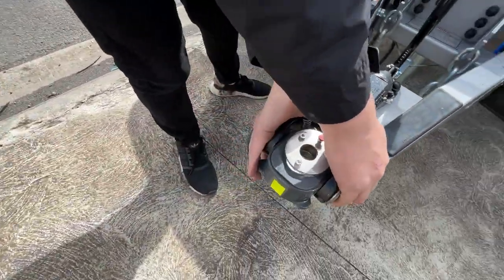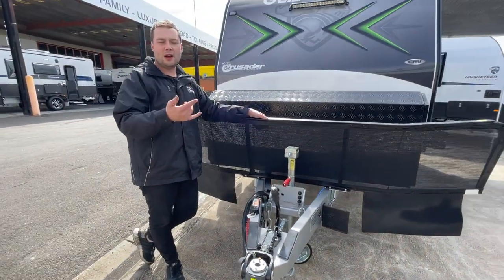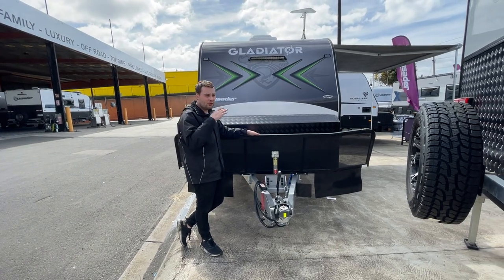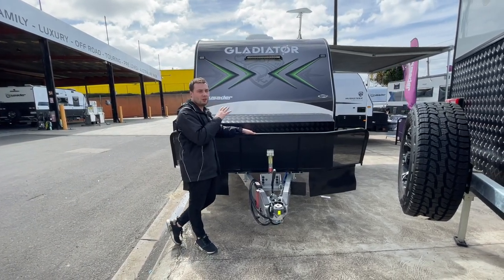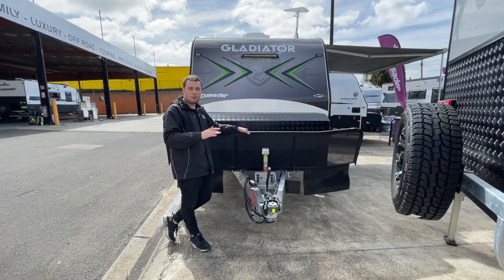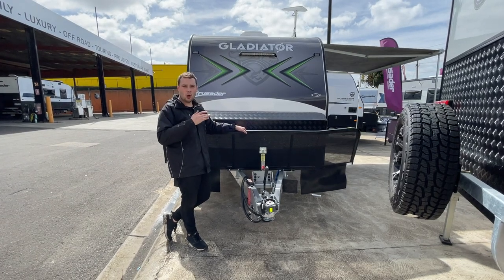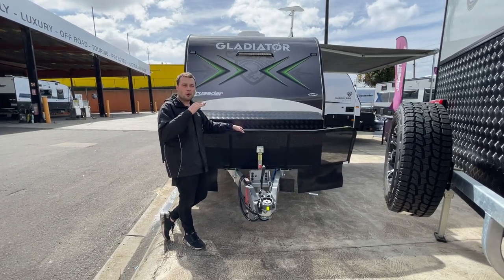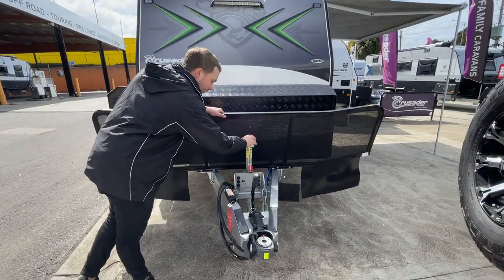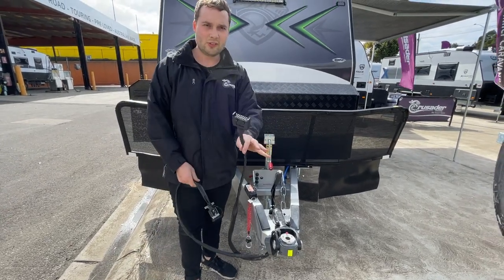DO35 coupling for rotative and full up-and-down movement — semi-recess coupling. We've seen these tow out with Volkswagen Tiguans and Hyundai products. Most vehicles, at that 2,200–2,300kg mark, this is only towing at just over the 1,500kg mark, so a heap of wriggle room and movement in the payload allowance. Given it's a fully composite caravan construction, the actual weight saving is fantastic. We've got a very easy-to-use winding jockey wheel. Running on this is an Anderson plug as well as a 7-pin flat — most vehicles will come standard with either that or 12-pin.